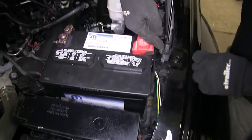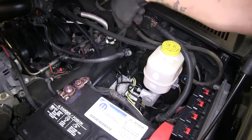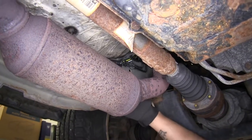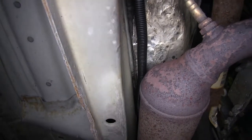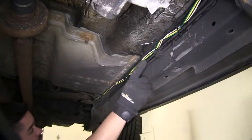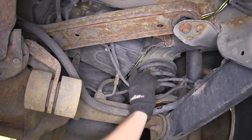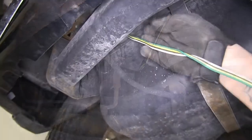I went around my battery, then came down over by my brake reservoir, and went straight down following the brake lines. This is where my wire dropped down from my engine bay. I put a piece of wire loom right here to protect it against the exhaust. I ran it down my frame, securing it with a couple of zip ties along the way, then went over the rear axle, up over the evap canister, and right over the fuel tank, dropping it down back here by my hitch.